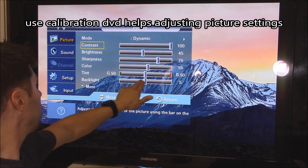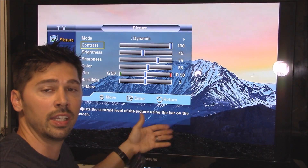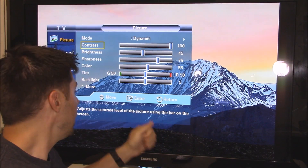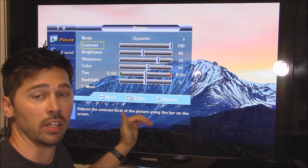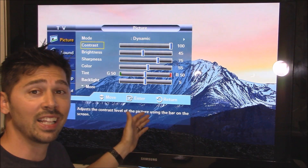Don't increase your backlight because that uses up the most watts. It increases the temperature inside the TV and causes more wear and tear on the backlight inverter boards, and also shortens the life on your CCFLs — the fluorescent lamps that run behind the LCD.